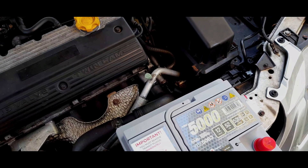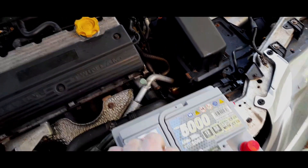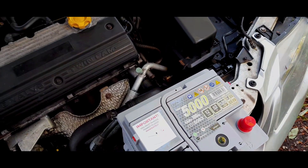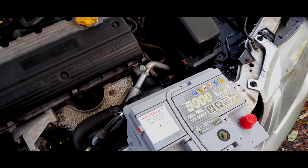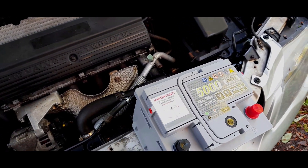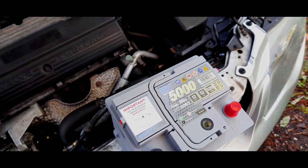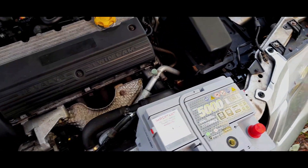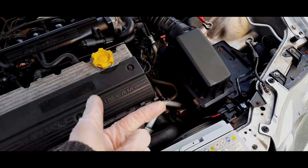My focus — the battery in the Focus has never been that great; it hovers around 12, 12.1, 12.2 volts even after a long drive, whereas this one is 12.6, which is exactly what a healthy 12-volt battery should be. But it's never let me down. We're going to pop this on and test the washer and the clock.